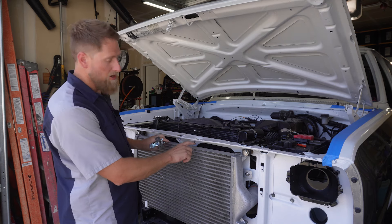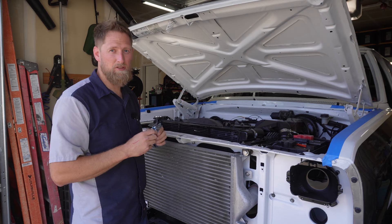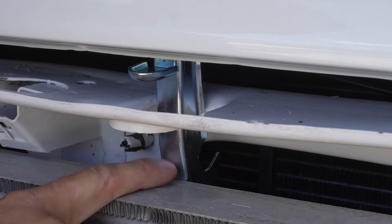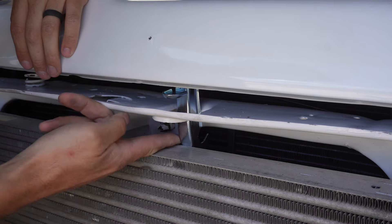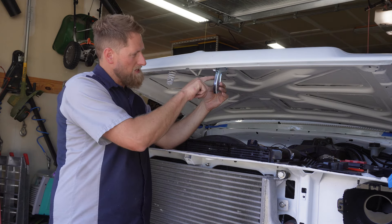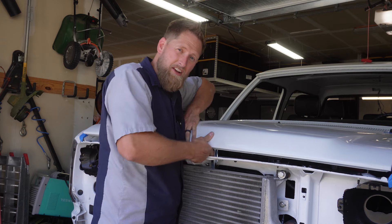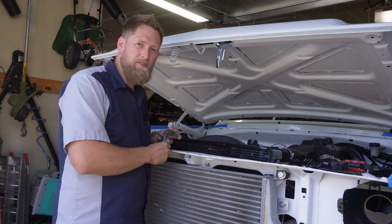We use a 7.3 intercooler and this is the hood catch — I know it's going to hit the intercooler. If I bring the hood down you can see it'll shut partway but we still have a ways to go and it's rubbing on the intercooler. We've got some interference. We don't want to rub either the intercooler or the hood latch. I've done this before and what I've done is cut out about an inch of the hood latch, shortened it, and welded it together. The problem with that method is when you go to unhook it, there's not a lot of room for your finger to get in there and it can hurt your finger because the grill is on there. So for this I came up with a different idea — I'm going to leave the length.